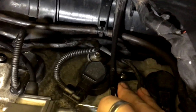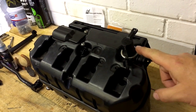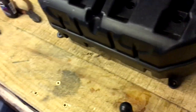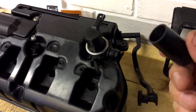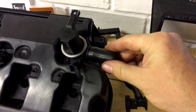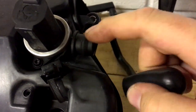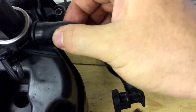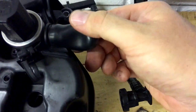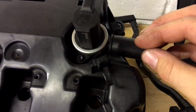One and the second one in there, which you can just about see. Now what we need to do is fit this rubber piece on the air box. So here's the air box, here is the recirculation valve, and here is where this piece of tube normally attaches onto here. You just remove that before you take off the air box when you're taking the bike apart. The rubber piece just sits on there. For me that's not mega snug, so I'm going to put a zip tie around the outside of that inner edge so it makes a tighter seal. I wouldn't even mind cutting this a bit shorter because there's a lot of material here, but I think I'll start off as it is and just fit it and put a zip tie around here to hold that on a little bit tighter.